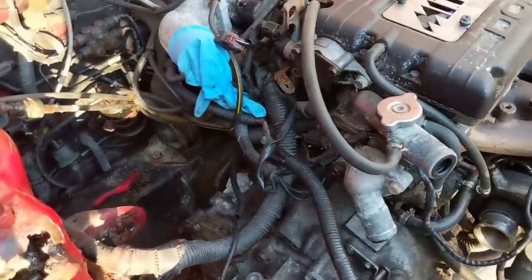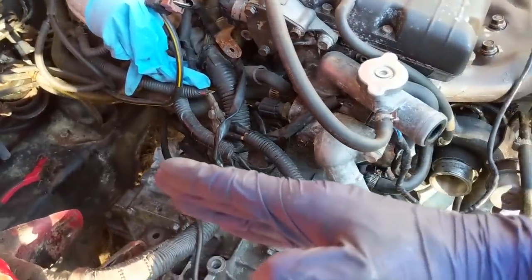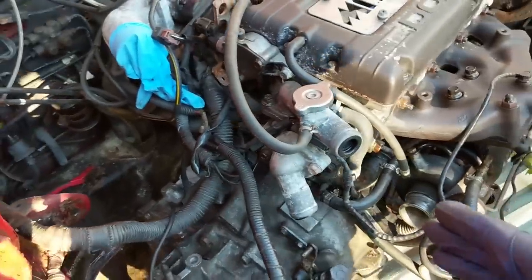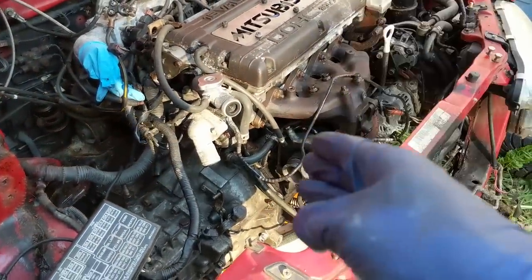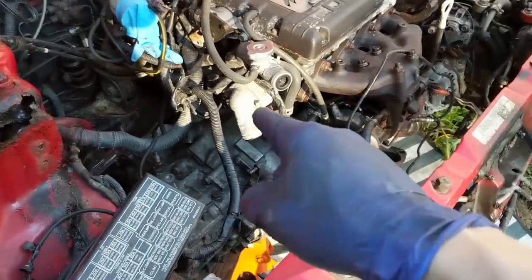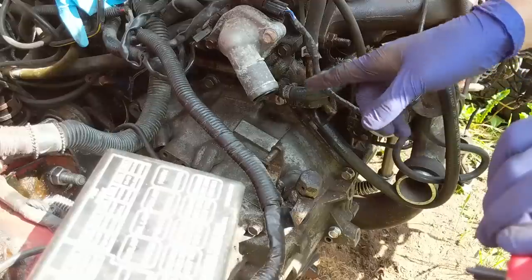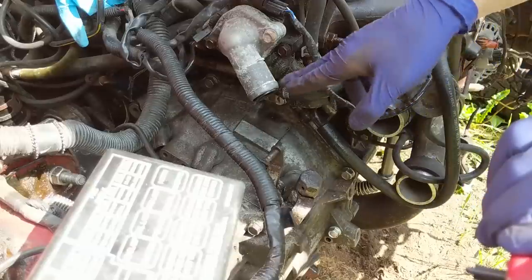You don't want to over-torque bolt Q; it doesn't take a ton. What Jaffro Mobile said — and this makes total sense to me — is that if you forget that bolt, which goes right down from that direction into the transmission, over time your transmission loosens up and flexes a little bit. All four of these bolts are on basically one half of the transmission, so even that little bolt with the lock washer keeps it from vibrating. Since this is all connected to the clutch and pressure plate, that little bit of flex can pull on the crank over time, ruin the thrust bearings, and make you think you have crank walk. Don't forget that bolt if you have a DSM.